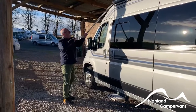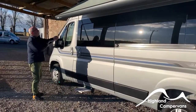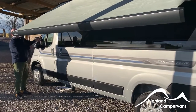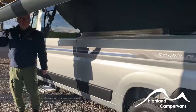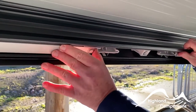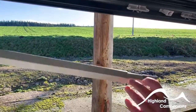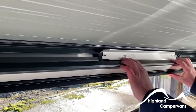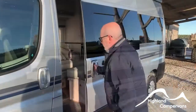Also stored in the rear of the vehicle is the winder for your awning. Always have the side door of the vehicle closed when you're winding the awning out. Bring it down to a comfortable height and then release the feet. The feet are released underneath the awning pelmet. It's quite a windy day today so we're not going to put the awning up, but the feet go down, get locked in place, and then you wind the awning the rest of the way out. These are additional cross members — as you can see on the instructions, they brace against the awning support.